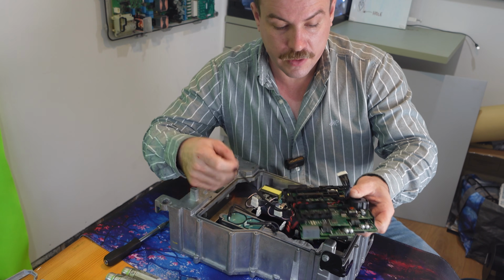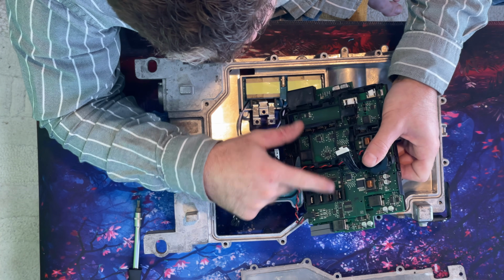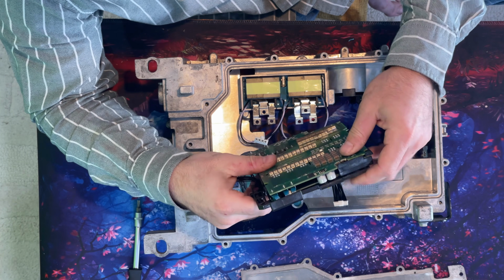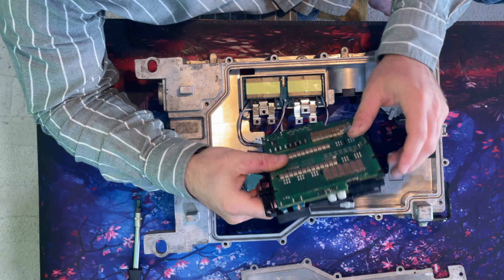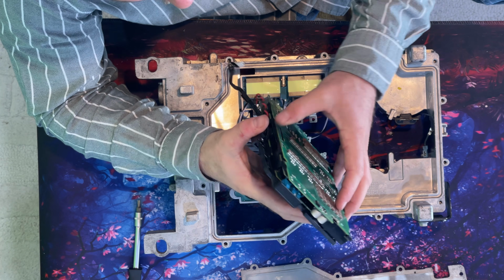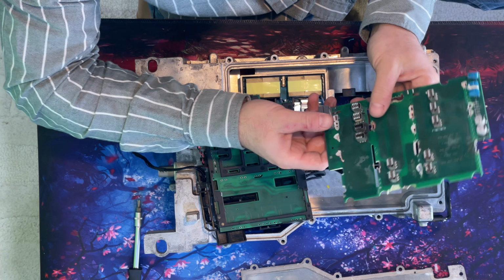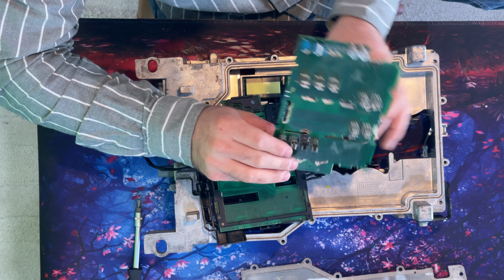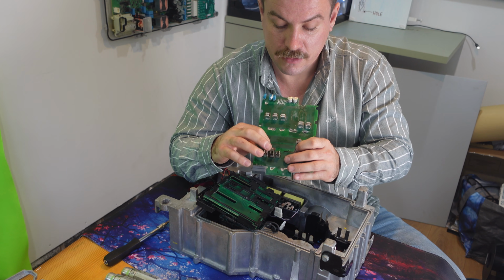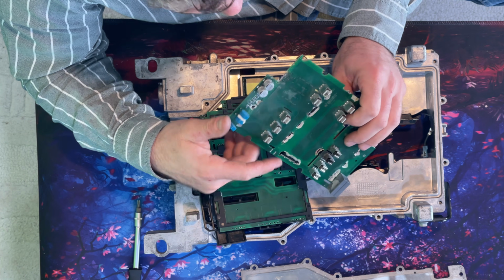So we've got more communications that lead back to our main control board, and there are more control pieces on top of this board. Now this is actually a sandwich of 3 boards, okay, that is heavy. There are some thick copper traces on the back of here, but if I can take this bottom one off for you, going across to our coils on the top side, there were some of these spring type retaining pieces, and you can see that this one here has visible signs of heat damage.